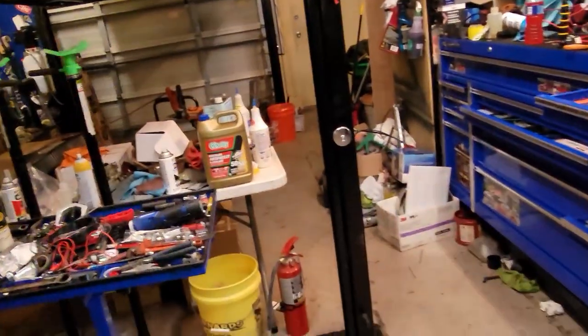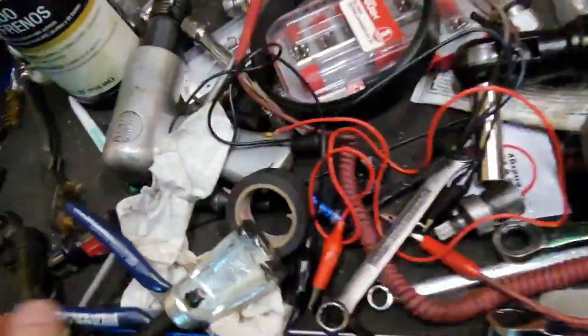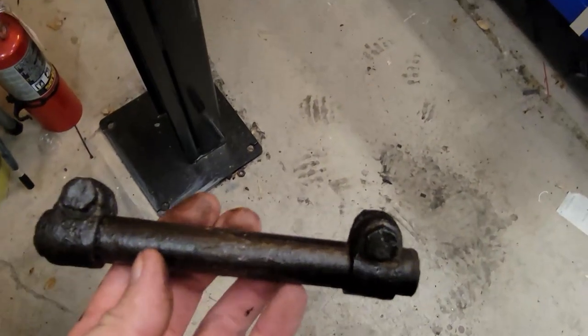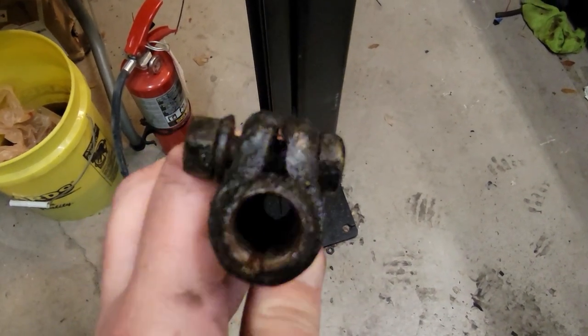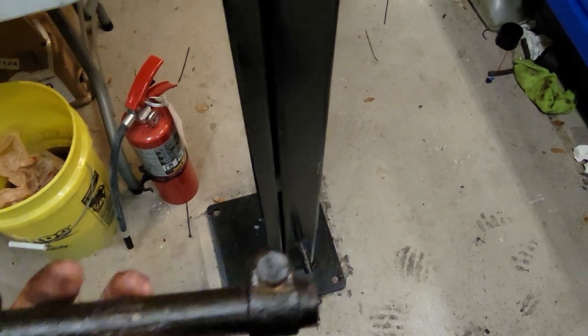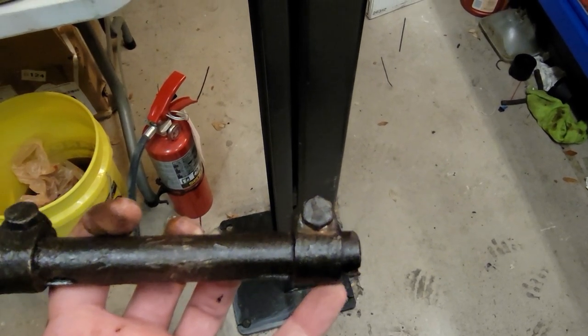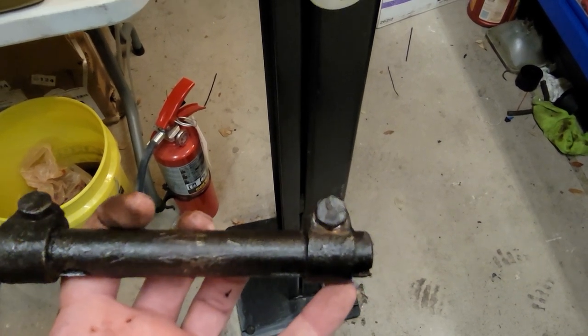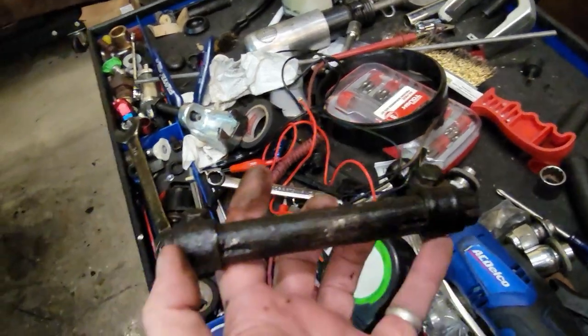We need roughly an inch because we took up 13/16ths — let's just call it a two inch gap, but it was inch and 13/16ths. Now that I'm relatively straight, they said these were bottoming out but they weren't — look, they're not even close. What was happening is the sleeve's too long and I ran out of threads at both ends. So I think what I'm gonna do is clean this up real good, look down in here with my bore scope, and if I got threads that go a good ways in here, I'm just gonna take three quarters of an inch off each end. That'll give me my inch to adjust and leave me a quarter to half inch of adjustability.